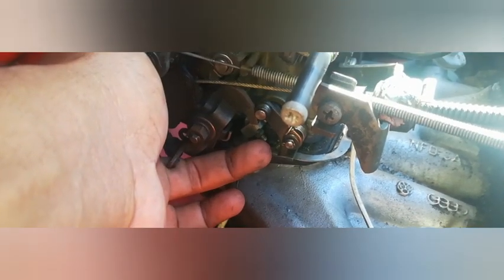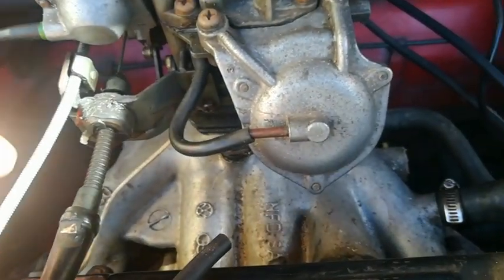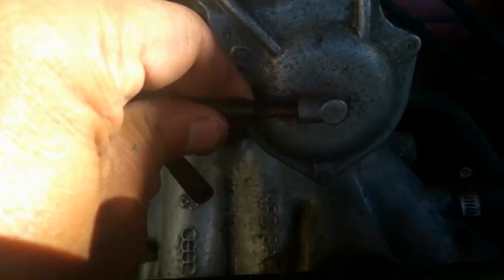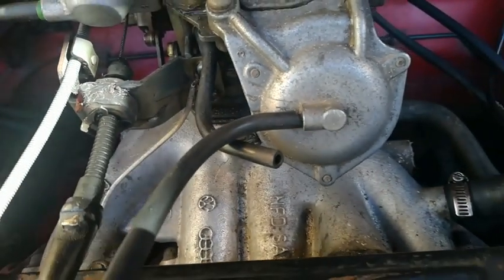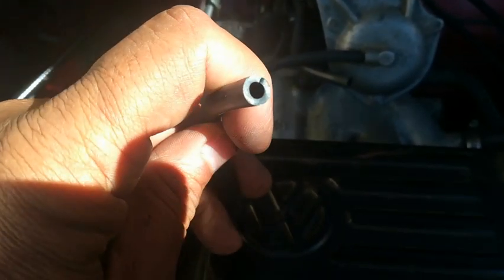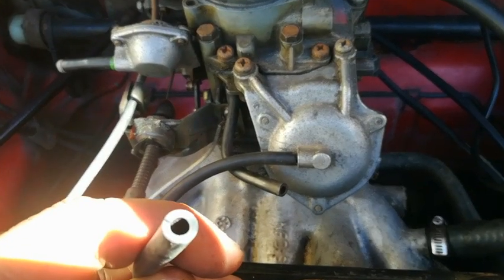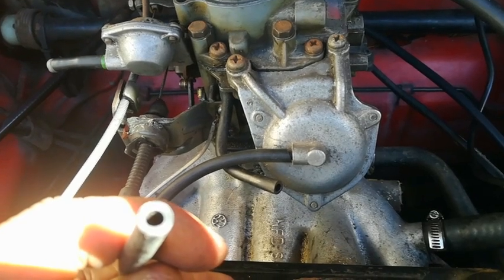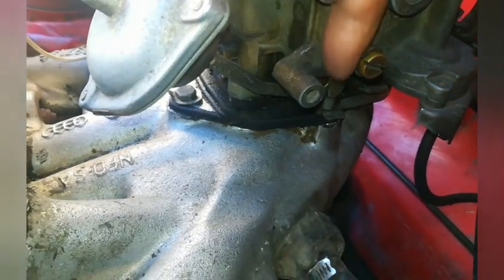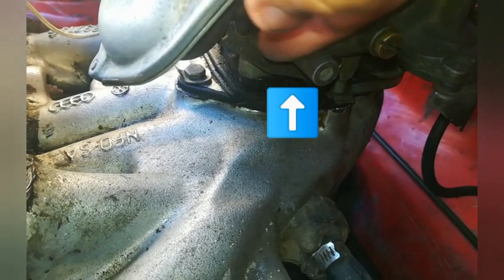There is a way to find out — I will show you now. To test your vacuum, the diaphragm inside: you're going to pull off the existing pipe and for the test we're going to put on a longer one. What I'm going to do is suck on this side, and when I suck on this side we will see if the lever is actually moving. That actually activates the butterfly in the carburetor, which means it's swinging open. As I suck on this pipe, this lever here will have to move.